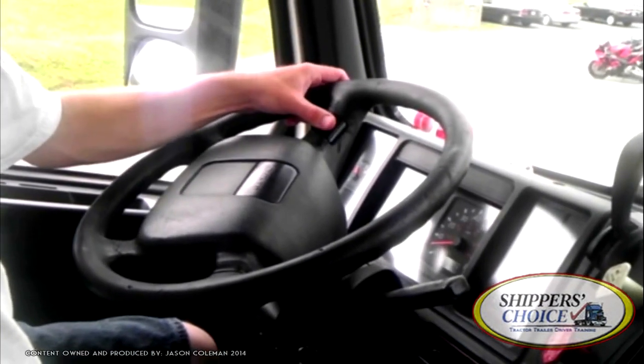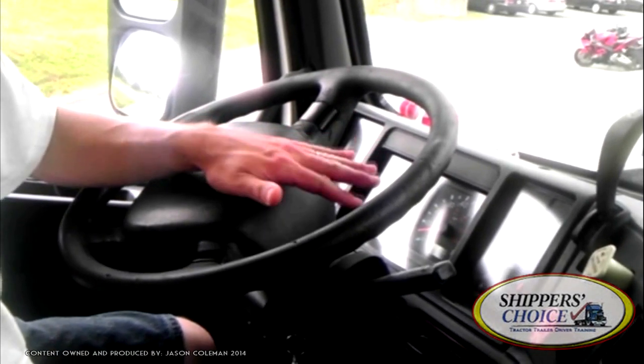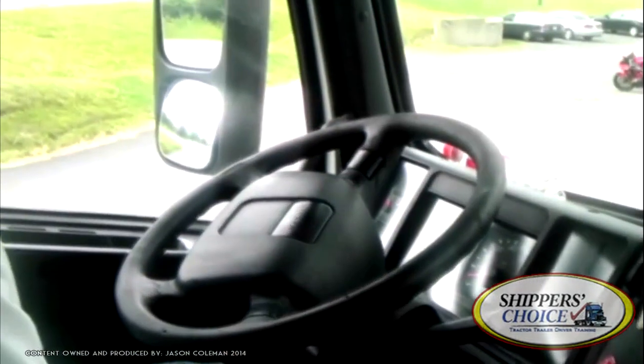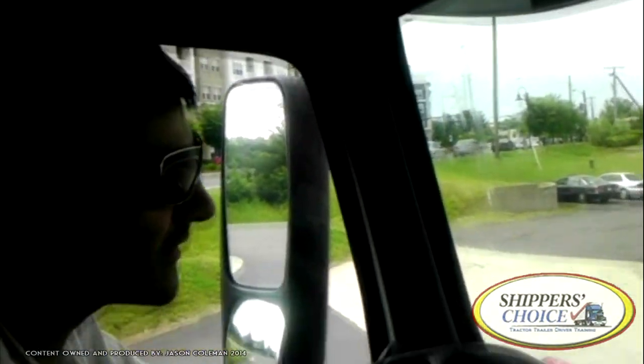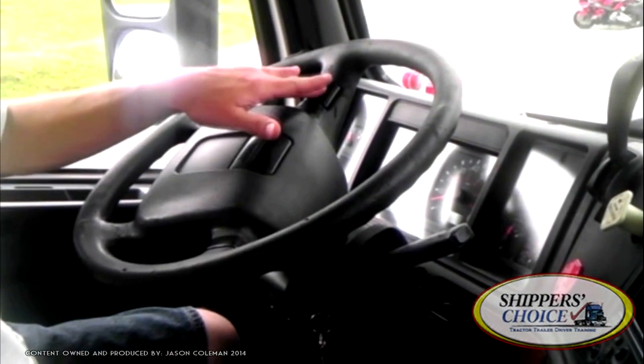City horn — working properly. My highway horn will be located in the center; I'm not going to sound that at this time out of respect for our neighbors. A lot of air horns are up top, with a little cable to pull. On these Volvos, they're in the middle of the steering wheel, with the city horn on the outside.